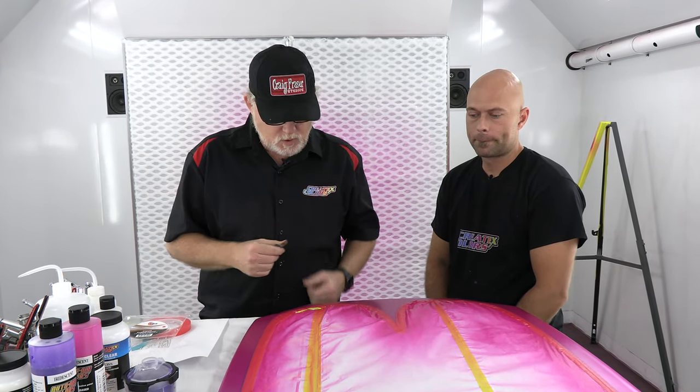Even with good coverage, the silver metallic is still going to come through in the sun — that's the cool thing about this color. It is a translucent color. If you're trying to cover primer spots, it won't work — get everything even underneath. Whatever base you put underneath this Porn Star Pink will affect it. You can spray it over black — it'll still be pearly, still have that holographic sparkle — but it is base determinant. It is not a candy, but it is candy-like in the way it sprays.